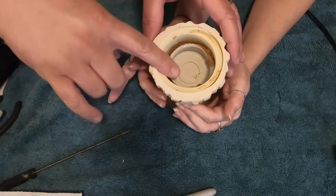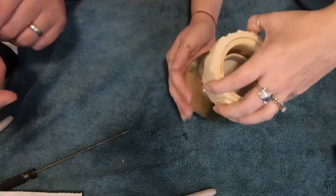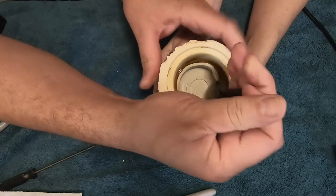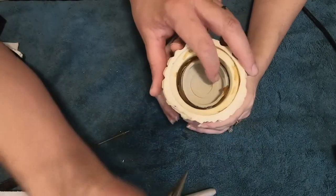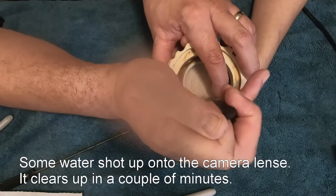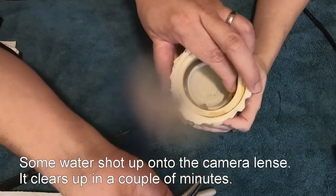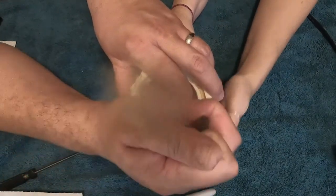Sometimes I use the razor knife if there's a lot of glue, but in this case there's only glue in a couple of spots. I've got it loosened up all the way around now. I'm going to take the needle nose pliers, carefully pull back on the rubber, grab as much of it as possible, and gently pull up. Then I'll move to the other side and try to pull it up evenly so it doesn't hit the side of the globe and break. Sometimes water will come splashing out of here.